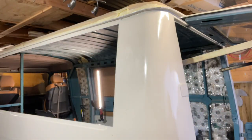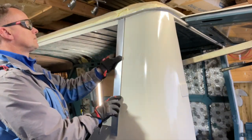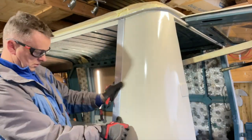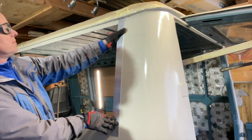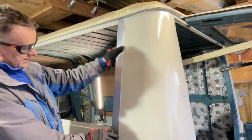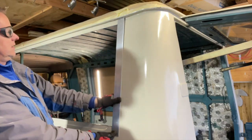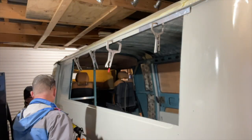You can see it now - just a small piece out where the gutter's not quite level, there's a little bit of weld there. These trims will be seam-sealered on and then riveted through the side of the van as well, so they'll be really solid once in place. Tiny tiny bit out of that - third time lucky, come on, it's got to be right this time. Yeah, looks nice. That is quite straight - it's a nice straight line. Not bad. Seam sealer in hand.